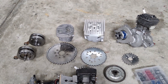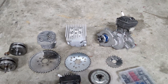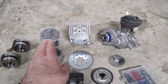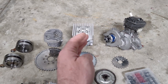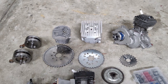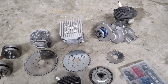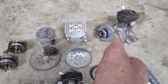Just like the 139cc bike I have. Then you've got one of the saw builds. These have a ton of low-end, mid-range power. They will pull something super small right out of the gate and run it. Now here's the difference: you've got this one right here which is all low-end porting — it's designed that way. The most you're going to get out of that is maybe 7k RPM. You've got a Minarelli here — the most you'll get out of that is functional RPM. We're not talking about idiots that can't set a clutch where it goes up to 14k and smokes the clutch. When you get one hooked and it goes, it's about 12k max. And then you've got a saw build running about 10k driving something small. A 28-tooth and a 30-tooth is not unrealistic for that.